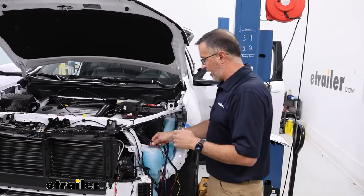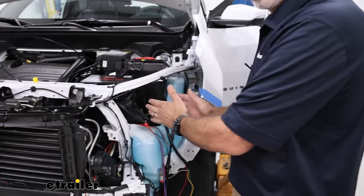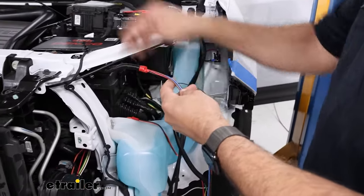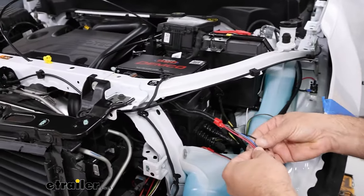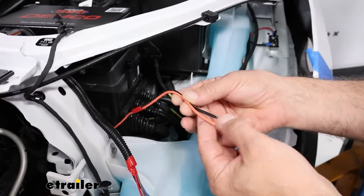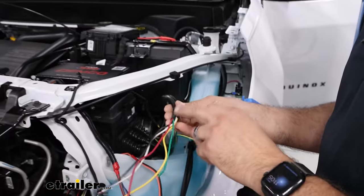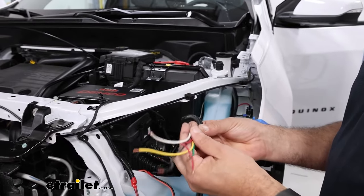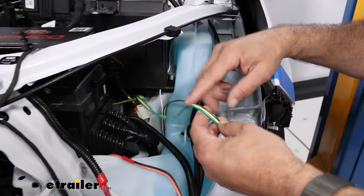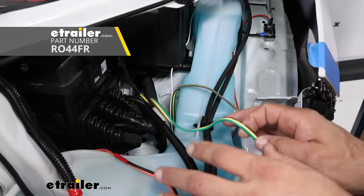We'll come back under the hood — this is where we're going to be doing most of our electrical connections, routed to one location to simplify things. This wiring harness is for our main operating unit, with four different colors. This is from our breakaway switch on the front of the vehicle. This wiring harness is coming from inside the passenger footwell — this is the g-force controller wiring harness. And then we have our tow bar wiring, the diode wiring installed previously on this vehicle.